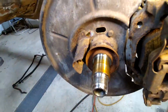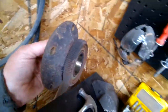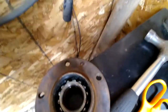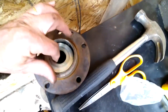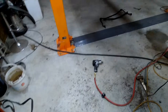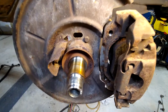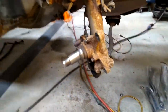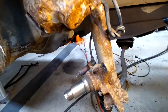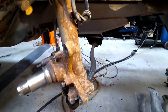There it is - that came out way easy. The big wrench took a bit of a turn on it but everything else is pretty clean in there. The bearing is in here - it's got this gear thing on the end, don't know what that does for sure. The bearing in there looks pretty good, likely just needs a bit of grease before putting back together. They're flat bearings in there, not cone bearings, so you just tighten it tight. I might as well order new wheel bearings and a brake rebuild kit since it's all apart anyway.